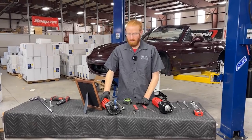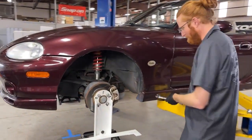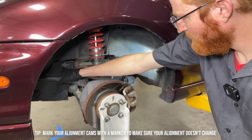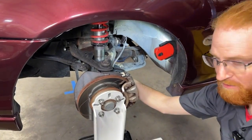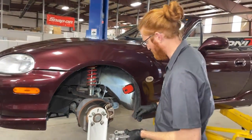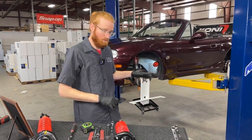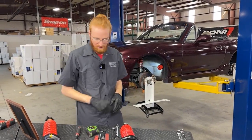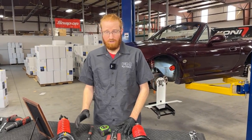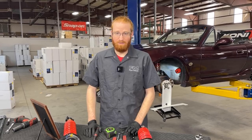One critical thing to do before you set these ride height measurements — or before you even adjust them — is to make sure the control arm bushings are loose. You have bushings on each control arm: upper bushings with one bolt going through both of them, and bushings front and rear on the lower arm. Make sure all those bolts are loose so the bushings aren't getting bound up while you make ride height adjustments. Once you're done, tighten them again before driving. Also roll the car back and forth — or if you have Paco hub stands, jounce the suspension at each corner — to make sure everything is settled before tightening back up. Failing to do this correctly can result in abnormally tall ride height or premature bushing failure. This procedure is known as indexing the bushings, and we receive a lot of questions about it.